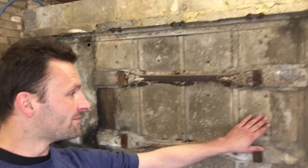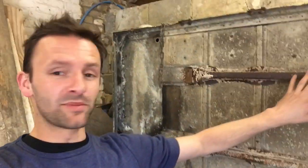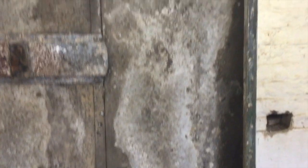Okay, so next job I'm going to take on on the Series 1 is behind me - it's the tub. As you can see, this is obviously the underside of the tub. It's just got a layer of sort of road dirt really. There's a little bit of corrosion on the cross braces. So the plan is basically to take a scraper and just clean it up and then give it an underseal with whatever I've got at the moment, because obviously you can't get anything. Just give it a general cleanup and then either a layer of underseal or some sort of stone chip.